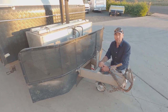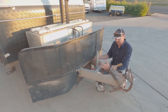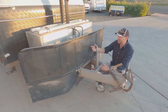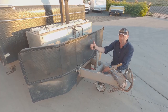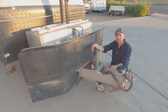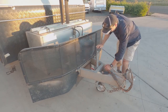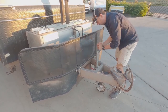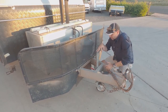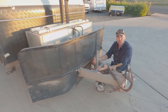This sort of setup is really common on a lot of vans. Jockey wheel at the front, it's got a clamp-on bracket with a red handle so you can take the jockey wheel on and off. Quite often you have a lot of stuff built up around the van — this one's got a stone guard really close to the handle, so as you go to crank it you can knock your knuckles on it. Over time jockey wheels get harder and harder to use, and this style, even when new, isn't that great. When it comes to levelling your van, you rely on the jockey wheel quite a lot.